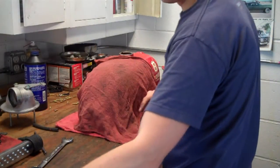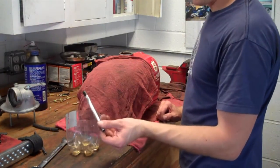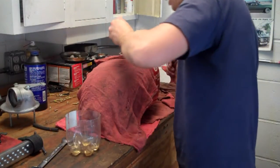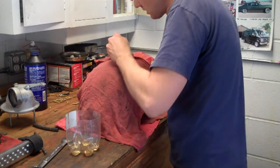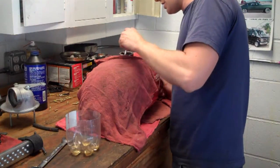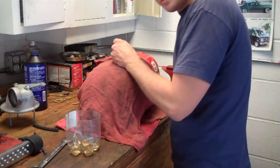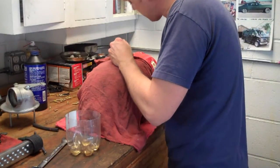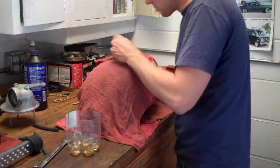For the paint, I'm using brake fluid — brake fluid and an acid brush. I'm careful not to spill anything on the paint here, and I'm just working the brush over the paint. It does a pretty good job of removing it. I just coat it lightly, let it sit for a few minutes, hit it with the brush, and it simply dissolves all the paint. Whatever I can get with the brush seems to be pretty effective.